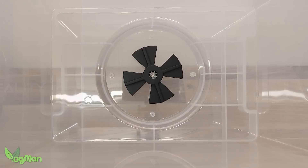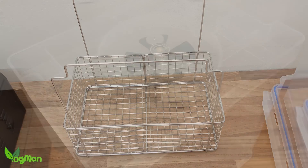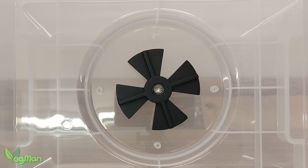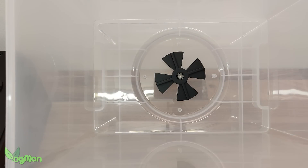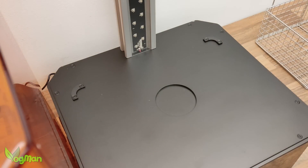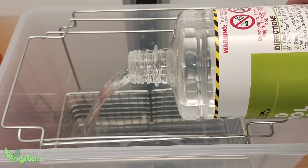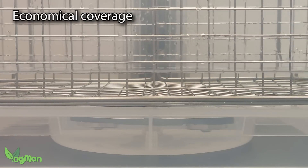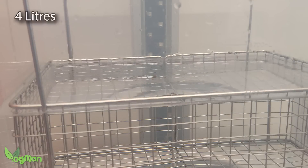At the bottom of the wash tank sits a simple impeller, but unusually it's in a sort of well. The basket has a flat bottom and no legs, and if we look at the underside of the tank, this well becomes obvious — a pretty clever and well thought out idea. The tank is also the biggest I've seen, with a capacious capacity of 9.6 litres. With just one litre of IPA or ethanol poured inside, the bottom of the basket is fully submerged and prints would already be at least partially covered — all because of this clever well. With just four litres, the basket itself is virtually covered.